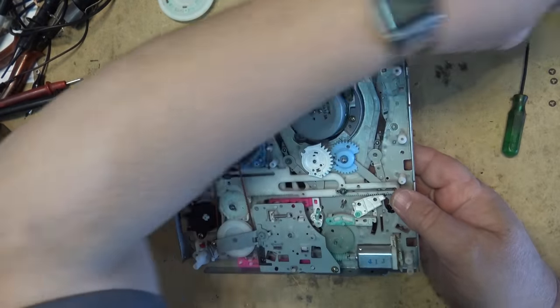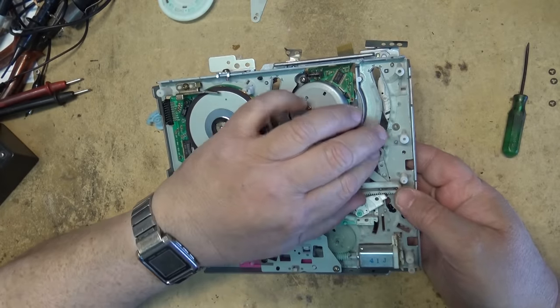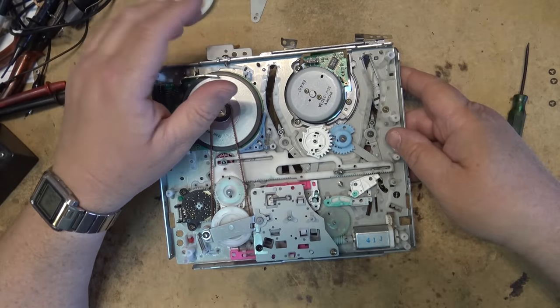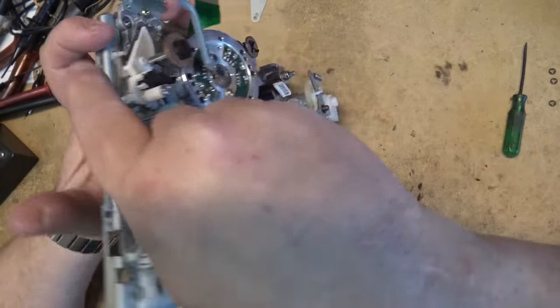One thing you have to check on these: quite often when this breaks, it's caused by the P1 guide breaking. This guide is actually pulled in place by a plastic arm, and if this little plastic arm breaks, the back tension arm will not be retracted back. Then as it's unloading, the guide jams up against here, the motor keeps turning, and it breaks the gear. Also, cleaning tapes — especially wet cleaning tapes — were notorious for causing this to get stuck and not move out of the way.